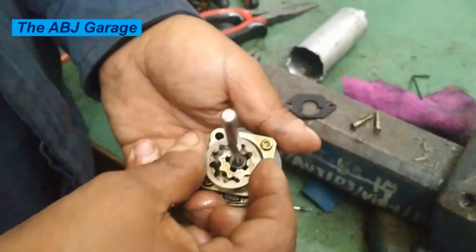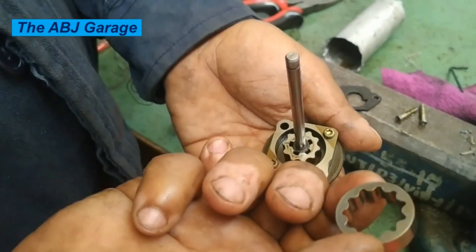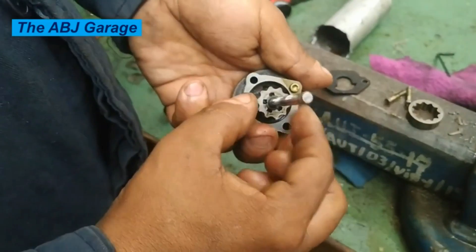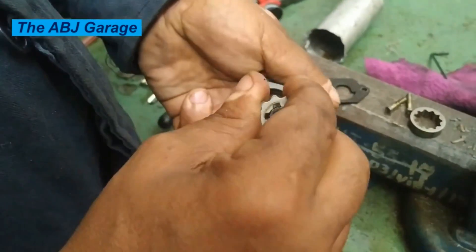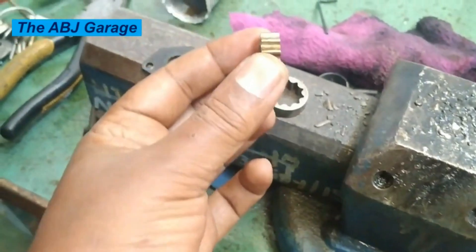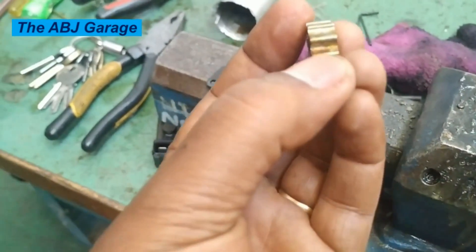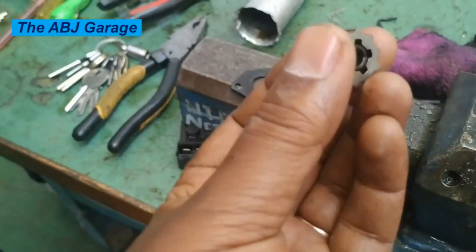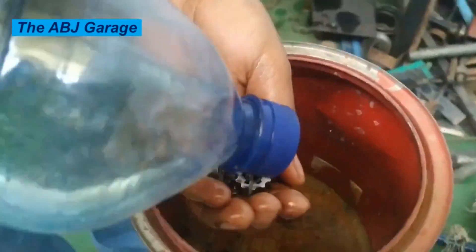Now it is stuck. As you can see, I'm removing the outer gear — the ring gear is getting removed — and then the sun gear will be removed and cleaned. By cleaning and reinstalling these we can restore the operation of the fuel pump. As you can see, there is some sludge and adhesive-looking material formed on the teeth of the gear, and this has a binding effect that prevents rotation of the fuel pump assembly.